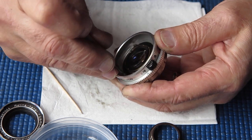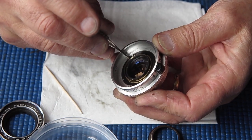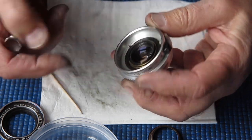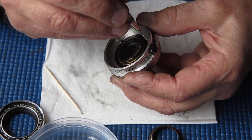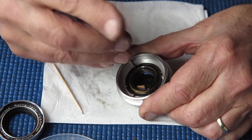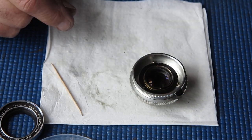I think that's the case. Let me slacken these 3 screws off. Try pushing that across to one side. Retighten those screws. Check the action. That's quite stiff. That was obviously not the right way to go. Slacken those 3 screws. Pull it over this way as far as I can. Nip those 3 screws up. Oh, that's got a nasty feel to it. Something odd's going on there. Right, out with that lens capsule, find out what's going on. I'll report back once I've got it sorted.